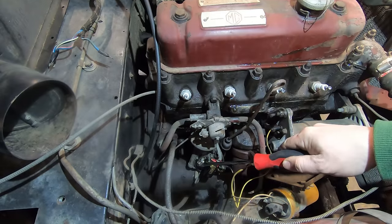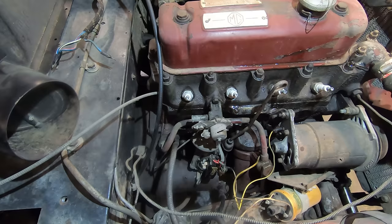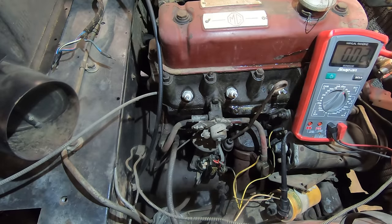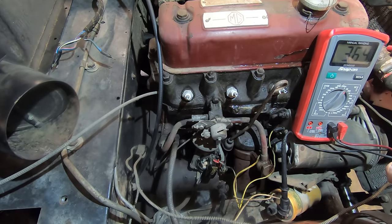The points look pretty good — they're a little bit corroded, so I'm going to clean those up. In order for us to get spark, not only do we need to have the distributor working properly, but we need power to the coil. I'll connect this to the power side of the coil. Right now we don't have any power to the coil, which we shouldn't, so I'm going to turn the ignition switch on and we'll see if we have any power. The ignition switch is on and we do have power going to the coil, so the electrical system is working well enough to actually start this.